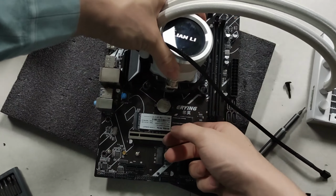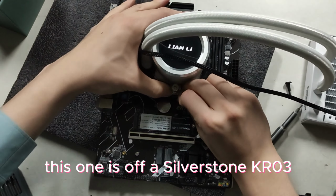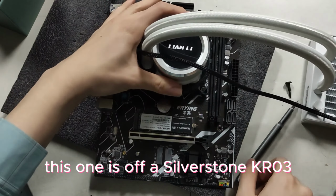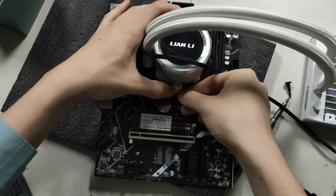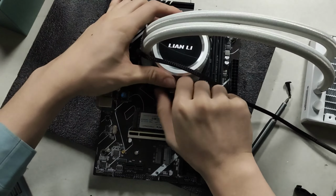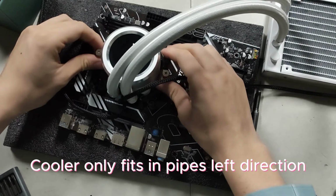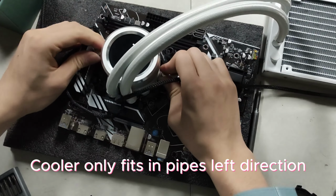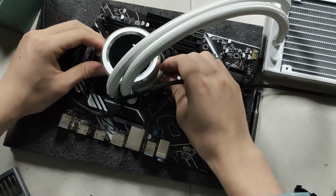Okay, take two with a different snap ring. Hopefully this one will work a bit better. Obviously, yes, this one works. The other one was just garbage. Okay, it's probably a little bit off. It's designed for thinner metal. So I'm gonna loosen this and try to tighten down two sides evenly, and that will really allow us to get a good grip on this.